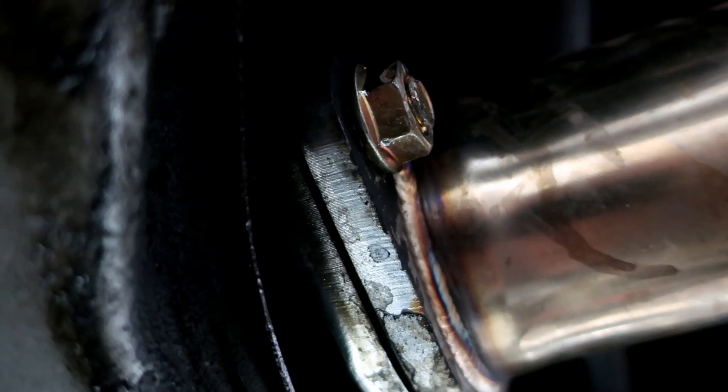I got the new bolts on. Let's go under. There's the big boy bolt — that just barely fits in the holes, unlike the ones that came with it. Put lock washers on both sides of it. This one here I think was a 14 millimeter like it came with, now it's a little longer than it's supposed to be, but I put locks on both sides — those little serrated teeth make sure it doesn't back back out. I used a heavy duty impact on it. I just want to check how the other bolts are doing up here — those are all right. We've got three bolts back here that all have not moved an inch. Super weird that the other one moved like that when these ones haven't moved at all. Very weird, but as long as it's still good, I'm happy.